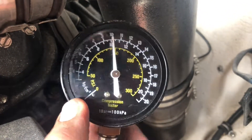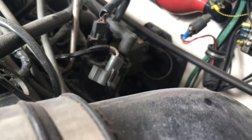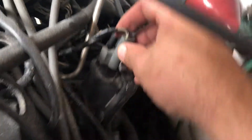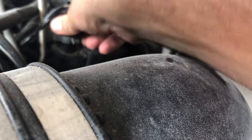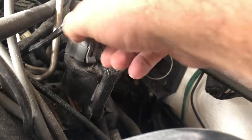So all of these are within a good range, but we'll go back to the manual in a second and take a look at what it says. Once you're done, don't forget to reconnect the ignition wires. And one other thing to note: after you've done the test on one cylinder, you should screw in the old spark plug and reconnect the spark plug wire before you move on to the next one.